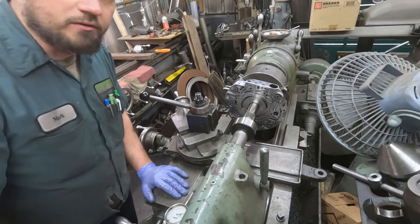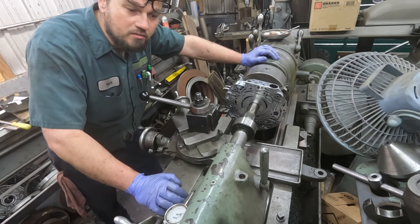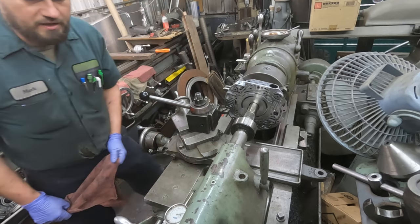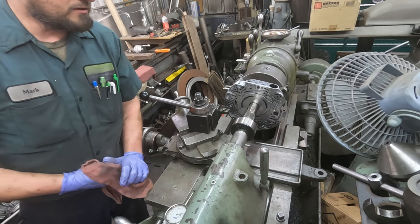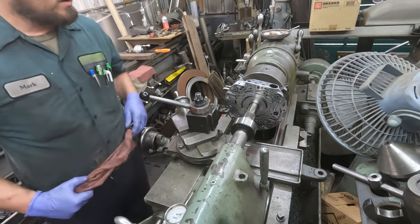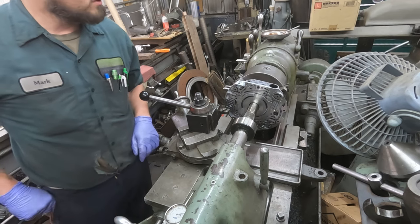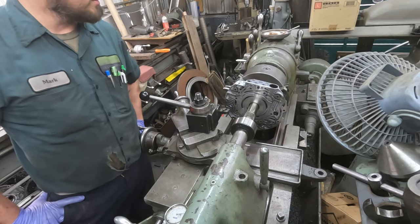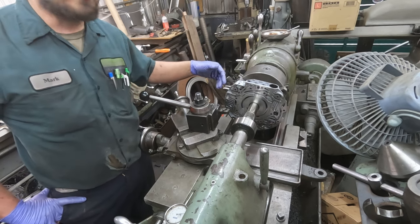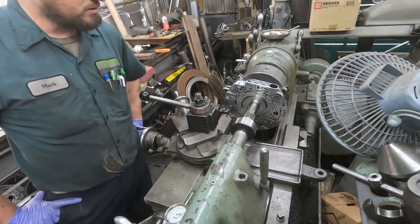And the lathe we're working on is, I think, about a 1942 Pratt & Whitney Model B. And the top speed on it's 525. It's not a fast mover, but it does everything I need to do in here. And generally for a transmission shop, the 12-inch lathe is just barely enough to do what you need to do on it. For a lot of pumps, some of the Ford pumps, which are a little bigger in diameter, they could just barely get it with the 12-inch.